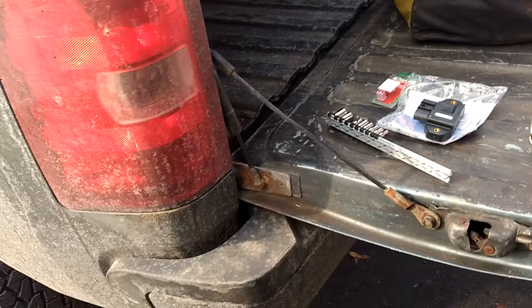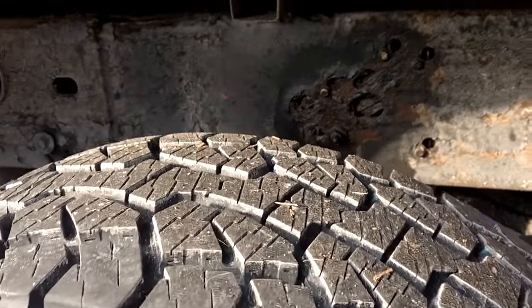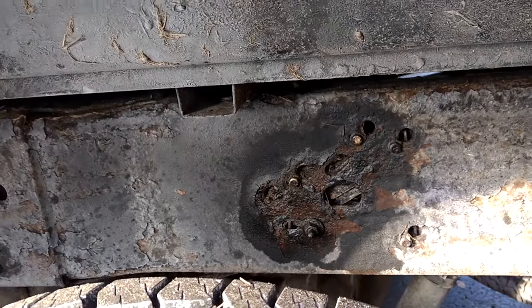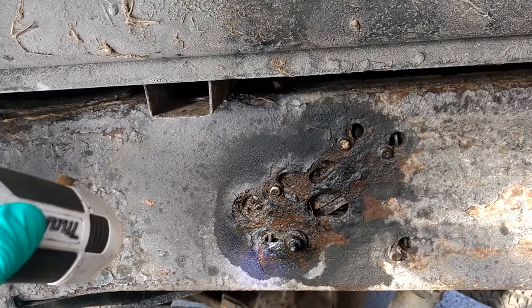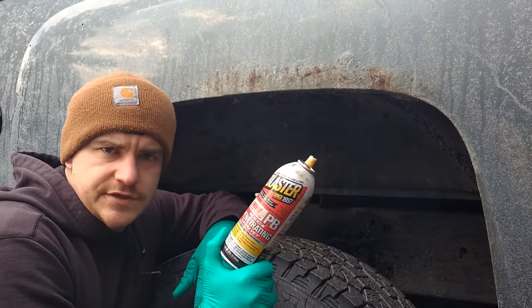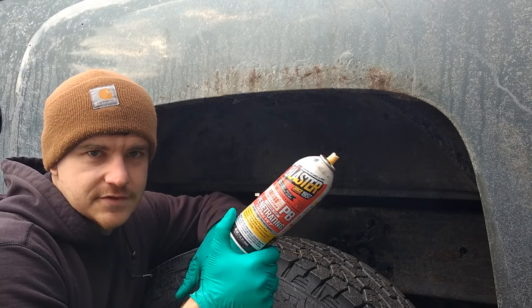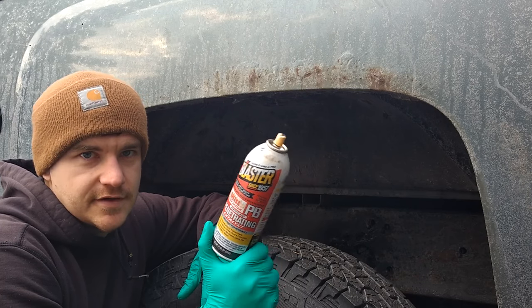My truck's a 2008 and I was able to locate this relay on the inside of the driver frame rail. The two bolts for it are right there and there — it's really cruddy. One tech tip: wash your truck before you do this. Don't be too proud to use penetrating oil — you'll save a lot of swearing, broken bolts, and time. Just spray it on the night before you do the project and you'll thank yourself.